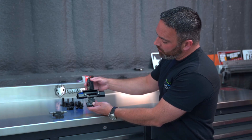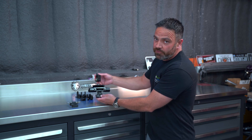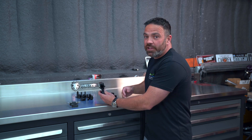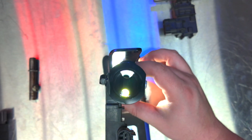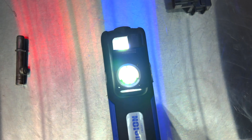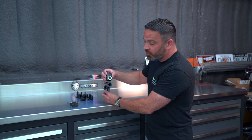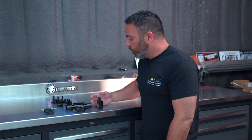This is literally five inches smaller, and you can add all of the same types of fittings and adapters right to this with much less space. As you can see with ours, the fuel flows completely through the sensor, and there is a whole lot more room for the fuel to flow through without any turns, any type of turbulence, or restrictions. We're solving the flow issue and the electronics issue in one shot.